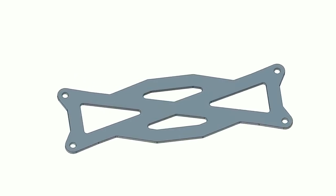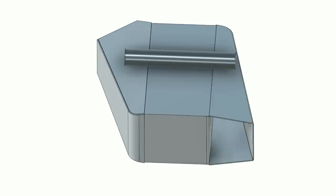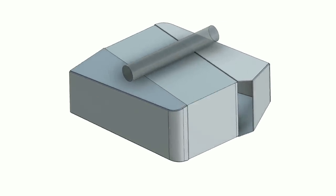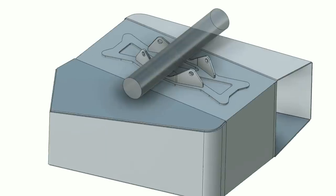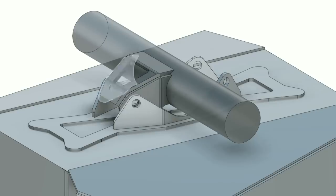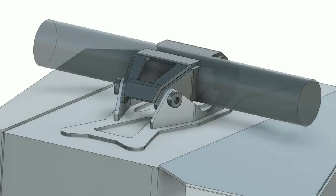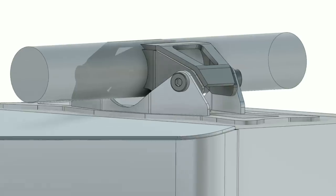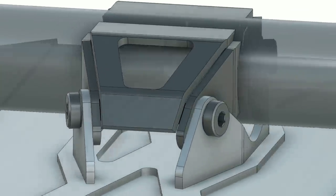This will allow us to share some design language between parts and keep cohesiveness among things we create in the engine bay. We drew up the intercooler itself, added a tube representing our spanning cross brace, and got to work designing the rest. Using a combination of aluminum to attach to the intercooler and steel to attach to the brace, we designed a mount that I thought was a good solution at the time. But after you guys made some comments, we realized that unless I absolutely nailed the welding procedure, this thing was going to warp and never go together the right way.